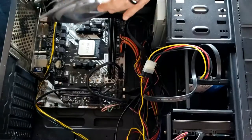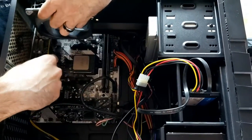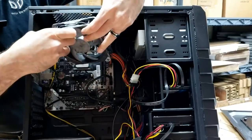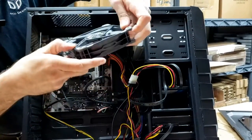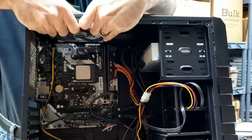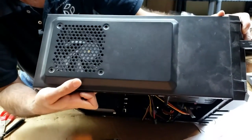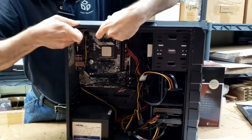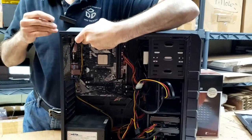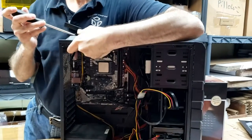Also think about how you're going to be routing your cables. If you've got a cable running up here, it might get in the way of a fan, so route it down below instead. You've also got these little finger guards or grills — think about airflow direction when installing. If you hook it up with the grill facing out, it's less likely you're going to get your fingers caught in the fan blades. We're going to line up the holes — there are holes in the top of the case — and pop the fan in there.